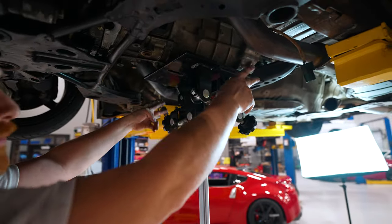All right, so you get all those bolts back in. Grab your interior trim piece. Pull your HVAC ribbon back in. Snap that guy back into place. And then you're gonna kind of rock it in front to back and pull it into fourth. That way it gives you a little bit extra wiggle room. Cool. Then pull your shifter through. There we go. And then just kind of start up at the top, work your way down, and it'll all press into place. Cool.